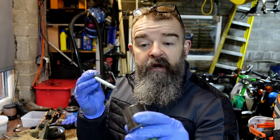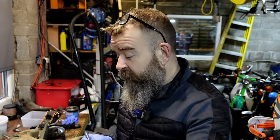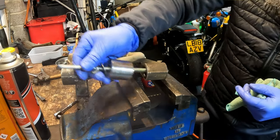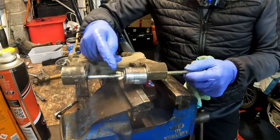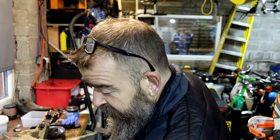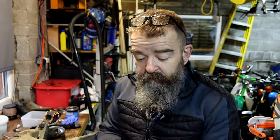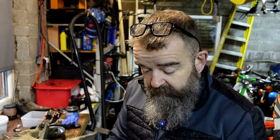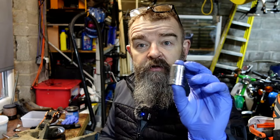We're going to pull these bearings out. What you need is a socket on one end, which the bearings will go inside of, because we're going to pull them into it. If it didn't go inside, you won't get them out. That's a 32mm socket, going on that side, which is captive with that wing nut. On the other side, we need to push the bearings through, and with that we're using a 21mm socket.